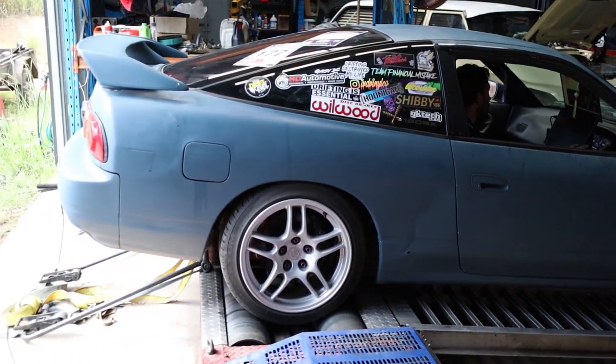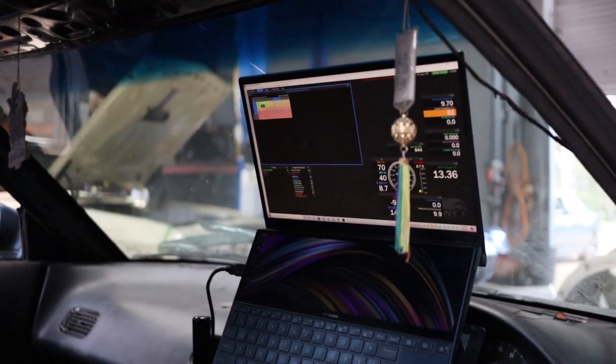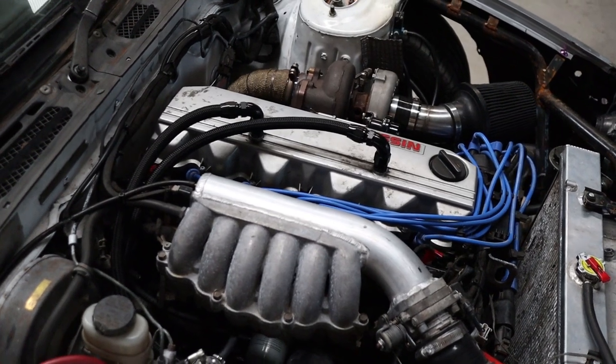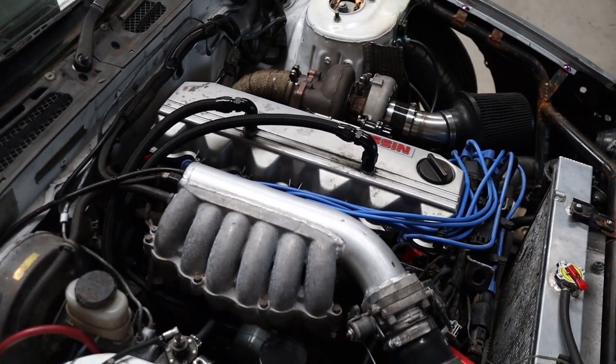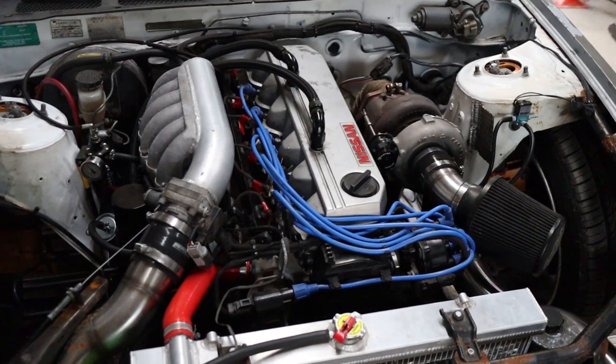So next on the batting list, we had a very cool RB30 powered 180SX, another Sunshine Coast car. Very, very basic setup on this one. Just a stock RB30. They just replaced the head bolts with head studs, running on E85 with an FG Falcon 3076 on it.